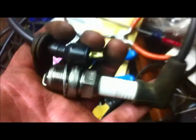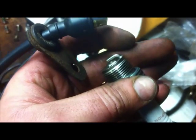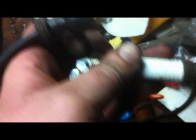I've got a nice new wire and a brand new Champion W14 spark plug gapped to factory specs. The old manual from 1961 says to gap it to 33 thousandths, so we've done that. Got a nice little boot here for the coil and a nice boot for the spark plug — we should be ready to test it.